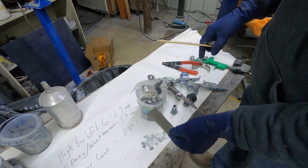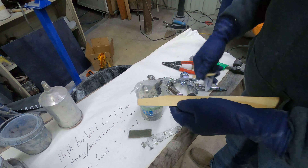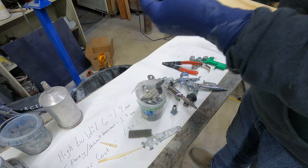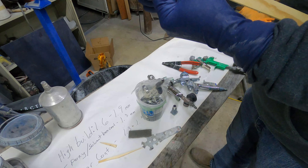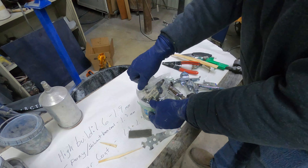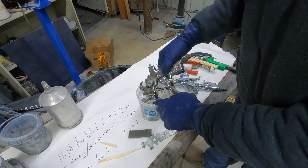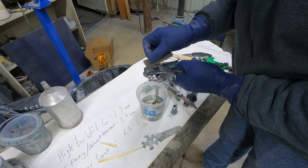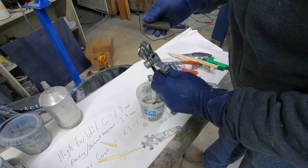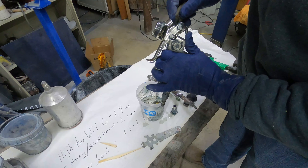My cleaning tools are pretty fancy — a chunk of gray Scotch-Brite, a wooden stir stick, and cut yourself some toothpicks off of it with a whittling device. Sure, they sell gun cleaning kits and you can buy one, but I'm just here showing you an easy way. Most of those gun cleaning kits come with metal pieces to poke in holes, and with the wooden stir stick method you don't risk messing up metal threads or those precision holes in your spray gun.